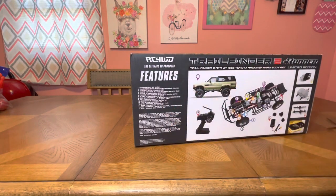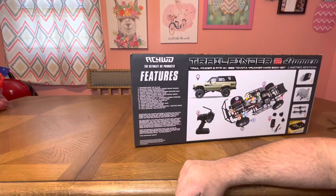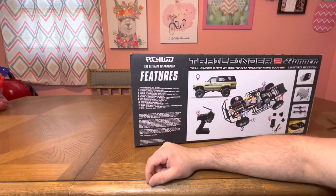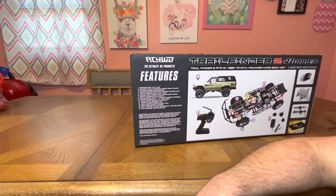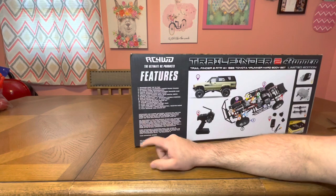It's a 45-turn — I always thought about going lower, but I think 45 to 55 are the two best you can get. Not the really high torque. It's a 540 crawler motor — big enough. Outcry 3 waterproof ESC, I can appreciate that. 6-cell 3,000 NiMH battery — good enough, and it's heavy, so it does have its purpose. Fully detailed.